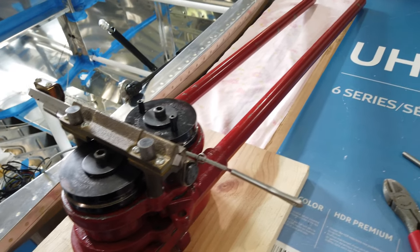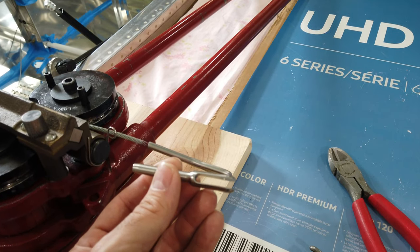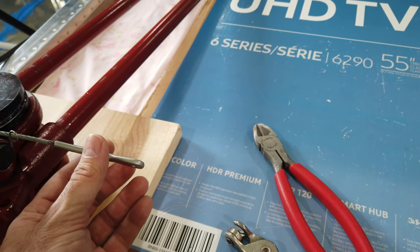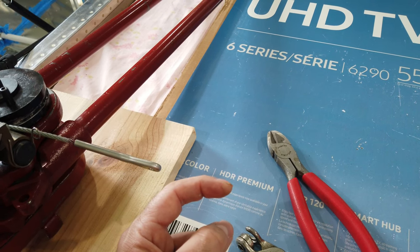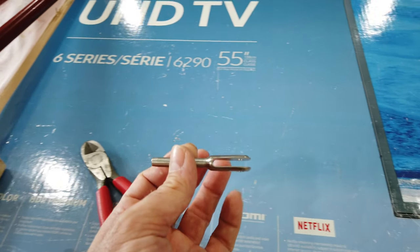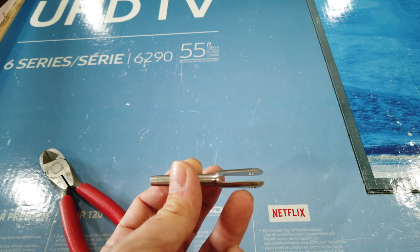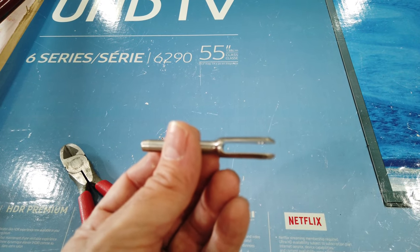I don't like that idea — it's just personal preference. What I'm going to do is cut this existing fitting off of the cable and swage on my own fork type of fitting. Rather than having a bolt going through the eyelet with a metal extension coming off the side and another bolt going through that extension and the ear on the rudder pedal, this fork will actually go around that ear directly. I'll use a clevis pin to go through it and the rudder pedal. I prefer these a lot more than what Vans has you do.